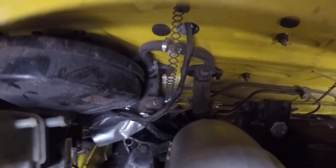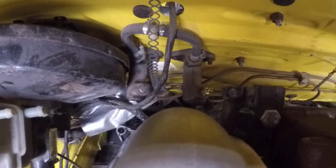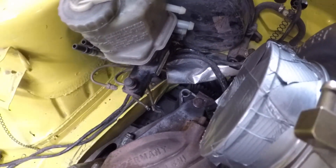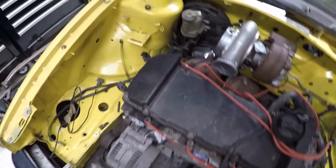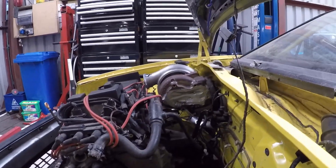As you can see it's in — not too close to the bulkhead, nowhere near the clutch or master cylinders, and more than enough room for the servo. I can get a filter in there, or at least a 90- or 45-degree bend to clear everything. The compressor outlet can come over here and down into the intercooler. I'm happy with that, and the bonnet shuts — I know this because it sits lower than the suspension strut top.